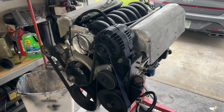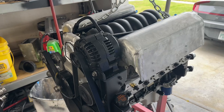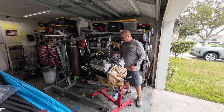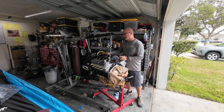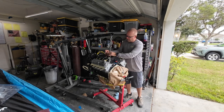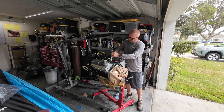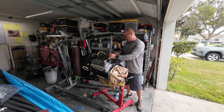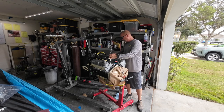Hopefully we'll be installing the motor this weekend. I should be able to paint it tomorrow or the next day, then let it dry for a few days and install it on Saturday. Now comes the boring part of scuffing every single inch of this. Paint adheres through chemical adhesion and mechanical adhesion. Chemical adhesion involves hardeners and adhesion promoters. Mechanical adhesion comes from the little scratches made by sandpaper, scuff pads, grinders, or whatever you use to make actual scratches in a surface.